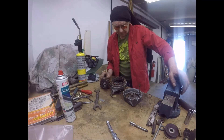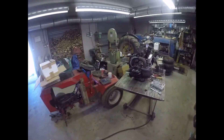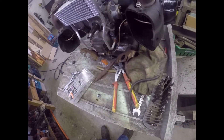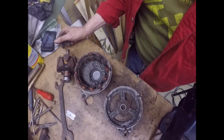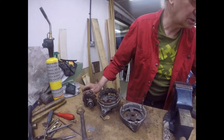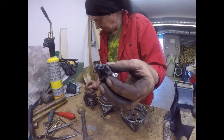It's the end of day one. The carburetor is back on the engine. The alternator bracket is back on the engine — that was a faff. The oil filler neck and the oil cooler are back on. The alternator is now stripped down. It's got very dry bearings as I thought, and quite a badly worn brush pack.